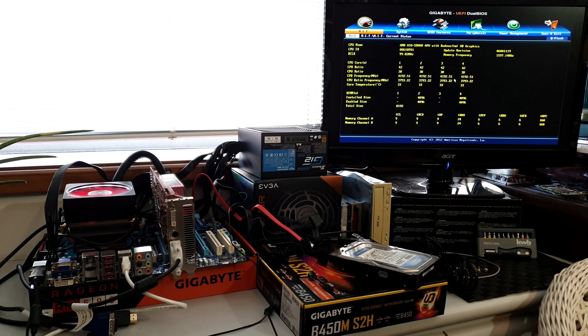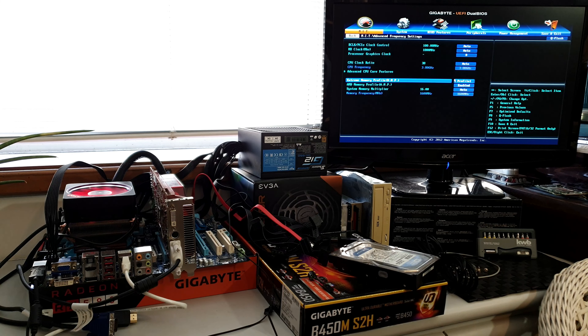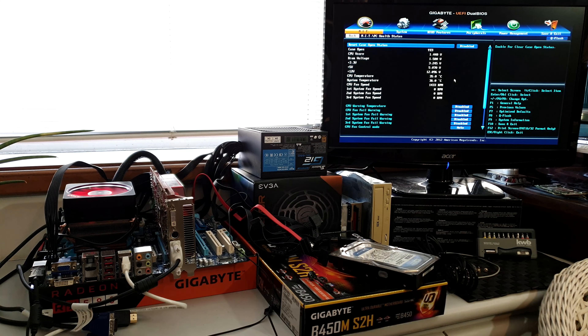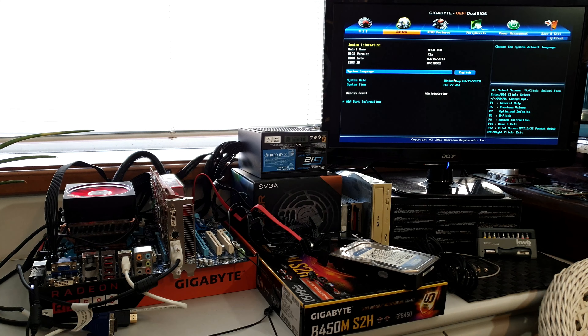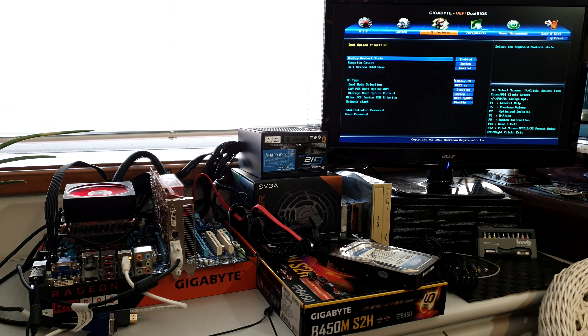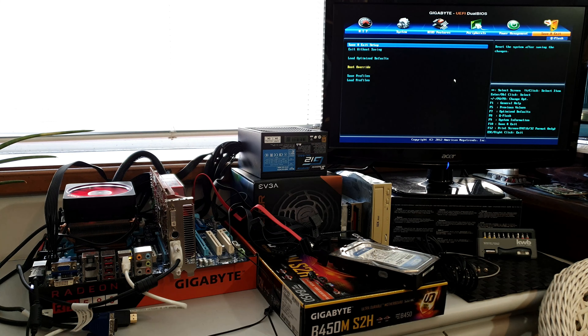Different things that I use: I always have the I/O facing me to plug and unplug stuff, because it's just easier. It's always handy to have a PC beeper around, not a PC speaker. And instead of powering on and off the system with a screwdriver — because you can connect both pins with a metal thing — I just use a regular ATX button which I mangled from a broken PC case. It's just a little switch and I find it very handy.